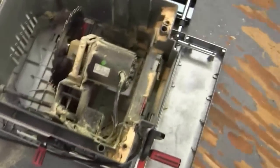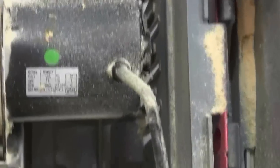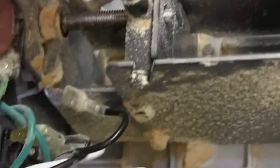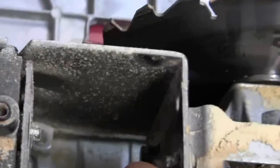I got the wheels off and the dust funnel off. Now I've got to figure out how to get the motor off. I think there's some bolts up under there, but I've got to follow that wire over to the box going in right here and see if I can disconnect those wires before I can get the motor out. I'm recording this so if I can't remember where the wires go, I'll have a video. Black wire's on top, white wire was on the bottom, and there's a ground wire right there — three wires to this motor, and then four bolts. I'll have this motor off in a second.